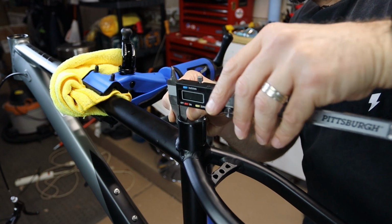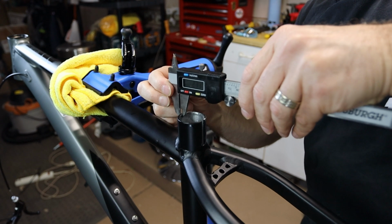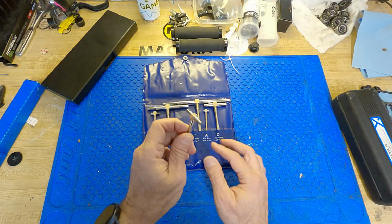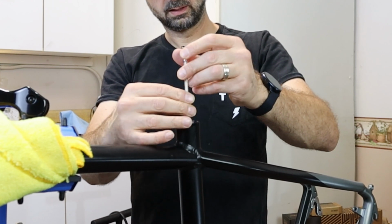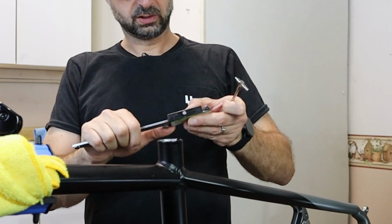It's extremely important to measure everything repeatedly. First off, we need to figure out the wall thickness of the seat tube. For good measure, I also measured the internal bore using my calipers, as well as this neat little tool called a telescopic bore gauge. Needless to say, after a little research, it turns out that I didn't use them correctly. Fortunately, my trusty caliper gauge is pretty accurate.